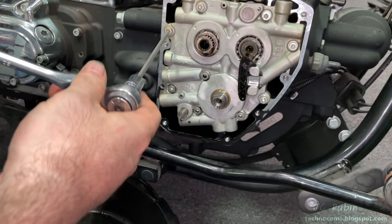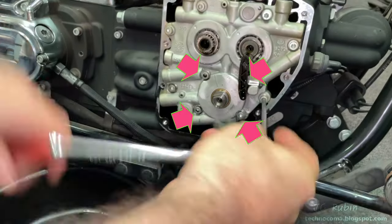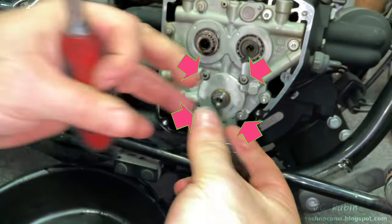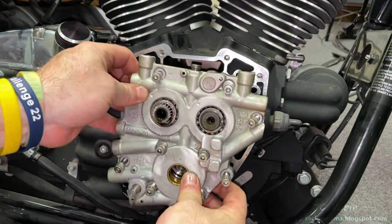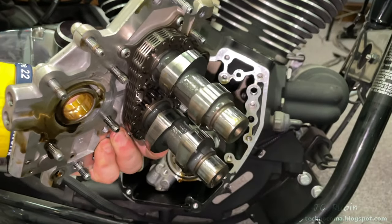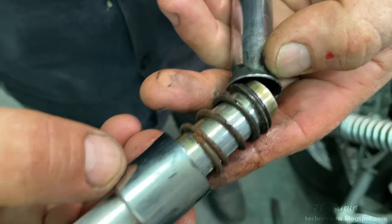Fair warning: if you are not servicing the oil pump, do not remove the four bolts labeled one through four. Oil pump removal is not required for this job, but we are doing it on this bike. With a 3/16 hex, I remove all of these bolts in a cross pattern. One bolt is behind a black plastic skid that I now remove — it's actually in very good, near-new condition. All these bolts are the same size, but I still keep everything together as I slide the whole piece off, being very careful as the cams are behind it.